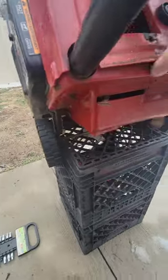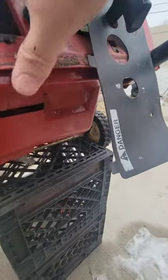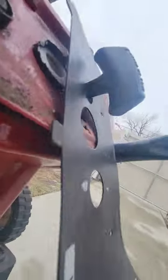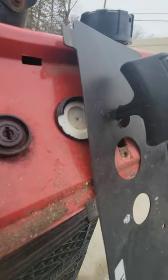So I'm just gonna go to the cover over here, raise it up as high as I could to give me some access. And then right there where the hose is coming out of, that's the primer tube. I'm gonna remove that, push the two tabs in, and that primer portion of it should slide forward toward me right there.